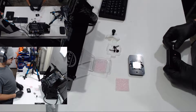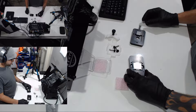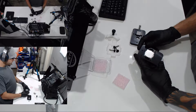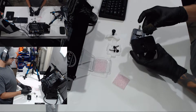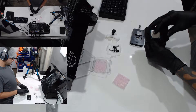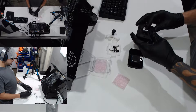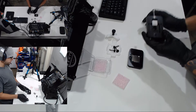When you're trying to overclock and squeeze every little bit out of a CPU, everything helps. I'm using the Rocket Cool delidding tool — I believe they call it the Rocket 88. It's real simple: you just put the CPU in, line up the two triangles like you would when putting it in your motherboard, and this is the part that actually knocks the metal IHS off.